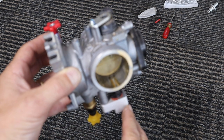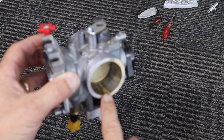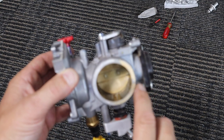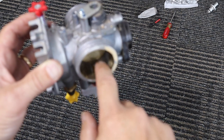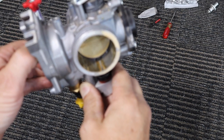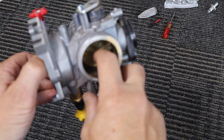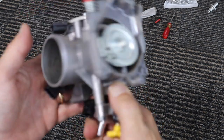This could be a decent reason why — I see all this crap in the throttle body. This is a lot of deposits from the fuel you get nowadays, and you can see it all in this throttle body. What's neat is you can actually see everywhere the fuel goes, because it squirts up from the injector right there. You can see how it travels out of the injector — your throttle plate opens and creates the strongest stream of air coming underneath. When it starts to open, the fuel is spraying up from here, and you can see how it's covered all over the inside of the throttle plate. It's fuel — you know why? Here's the other side.